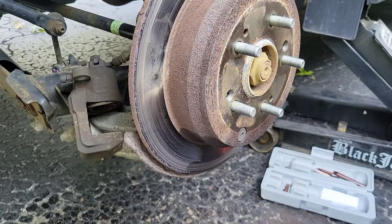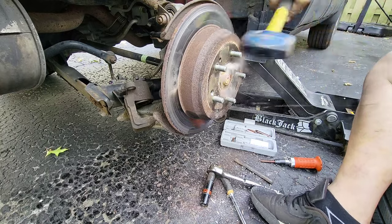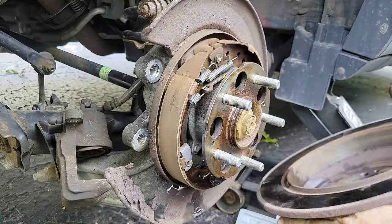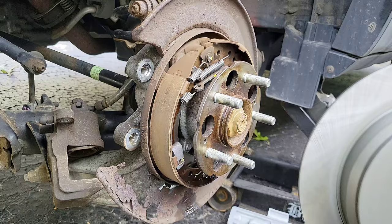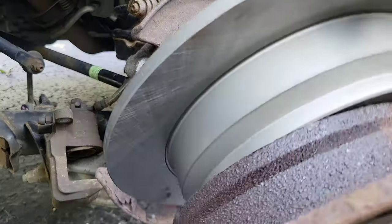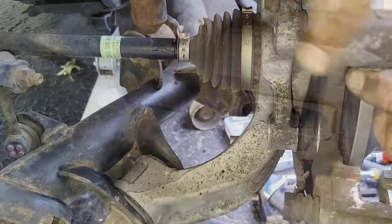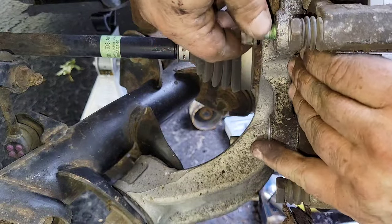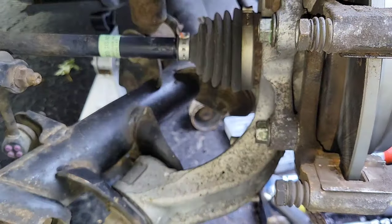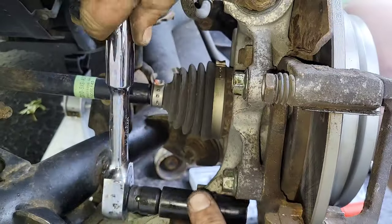The drill would have taken 45 seconds. I do not reinstall the rotor screws, to let you know — you don't need to, I don't care what anybody says. The beating commences. It worked its way out. There's a big rust ridge — it's stuck on that. First thing you want to do is match up the new rotor to the old one, make sure they're the same. I'm going to hit this with some brake cleaner and wipe it off. Got a new little bracket here — clips right in there. Slide that back in place. Tighten this down.